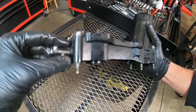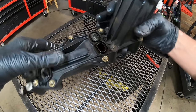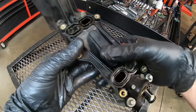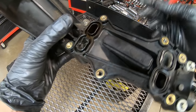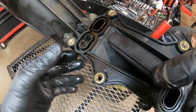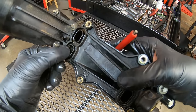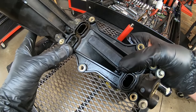We didn't have an issue with any of these fittings right here blowing or cracking, but in this case it was coming from there. That's another key place that you can leak coolant from. We've got different passages here — different ones are for oil, different ones are for coolant. What happens is, over a period of time, that plastic gets dry and brittle and starts getting a little flexible. You can actually see — as I was pushing on it earlier testing it — a portion of that wall where the O-ring goes around actually just crumbled. I've seen those get blown inward, and that's where the coolant would start coming outward. So that's another failure point if you've got a coolant leak.